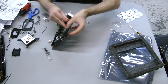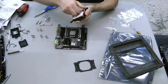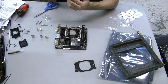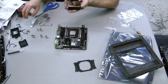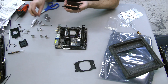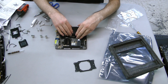It can be difficult to line things up since EKWB doesn't offer any way to hold the backplate in place other than manual pressure. With the mounting system in place, remove the protective sticker from the bottom of the water block and determine how you're going to need to orient the inlet and outlet on the block, handily marked in and out. For this build, I need the outlet on the side closer to the video card. Squeeze a dot of thermal grease on the CPU heat spreader, then slide the block down on the mounting posts.